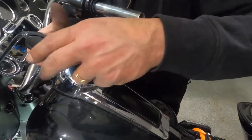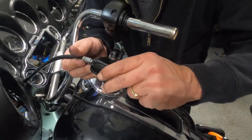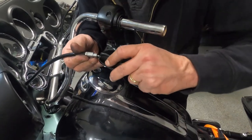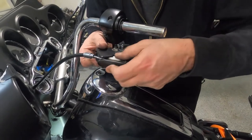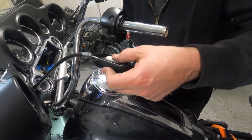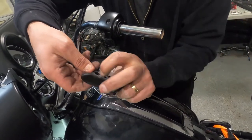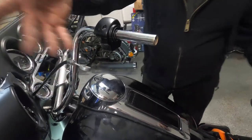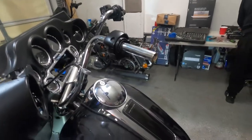All right, so that's how it was. After you loosen the clutch cable, you can pull it out, pull it this way through that groove. Now it's loose, you get it out, and the white piece, you push it, then you disconnect the cable. Now you have a disconnected cable. Okay, now let's take the whole fairing out.